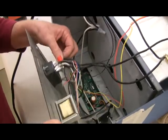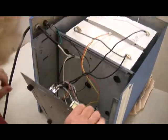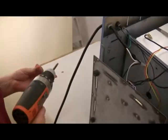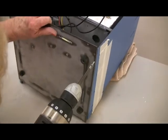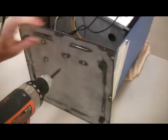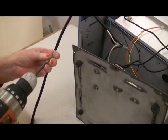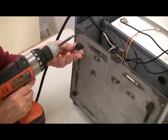Check to make sure all of the wires are still tightly connected to the kiln. Then reinstall the bottom pan with all the screws. Make sure you do not pinch any wires. If the front control panel has become loose, press it down into the flange on the front of the kiln. Then reattach the front control panel with the screws in the bottom pan.